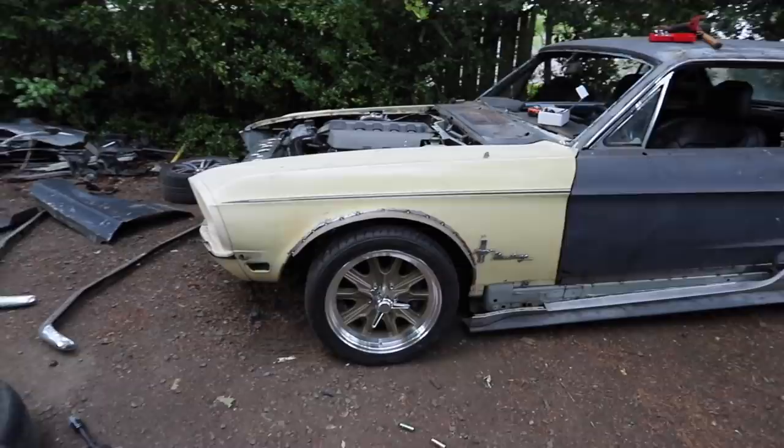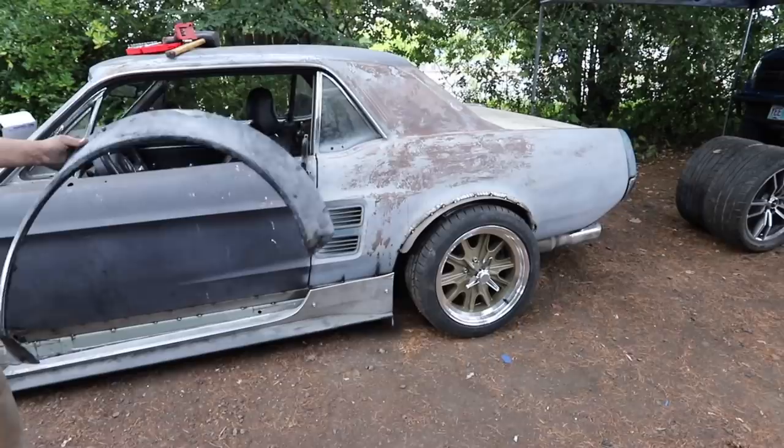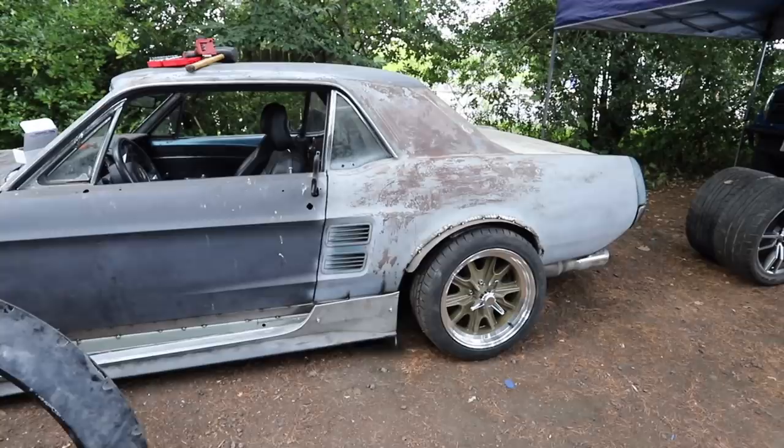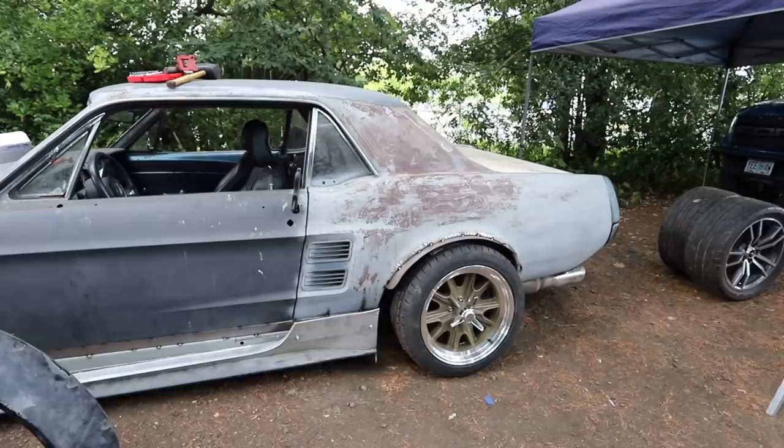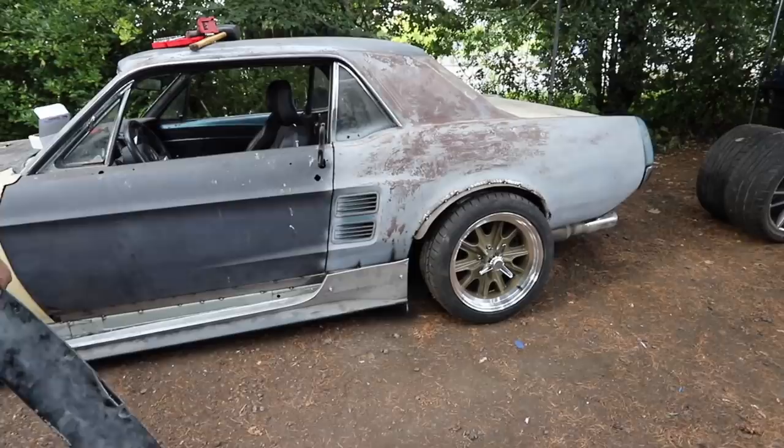So it's time to move on to installing the rear over fenders. We wanna do something creative so the bolts don't look super shiny. And so we'll think up something, either self-tappers. They won't rust, though, very quickly. We could paint them. Put a coat of paint on them that'll chip a little bit and rust on the edges. How about that? Yeah, so we'll throw a coat of paint on a set of self-tappers, and then as we hit them with the impact, it'll kind of knock the edges off, so it won't look super shiny.